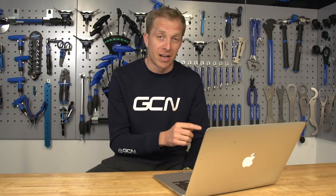Yep, you're dead right. At home I actually use an 11-speed 9150 Dura-Ace DI2 rear derailleur paired up to some Ultegra 6770 10-speed shifters, and it works absolutely fine. So yeah, you can mix and match. There are some compatibility issues with 11-speed rear derailleurs and 10-speed front — they don't work. So if you are going to start changing things around, just bear in mind that you will end up basically having to go to an 11-speed front derailleur as well.